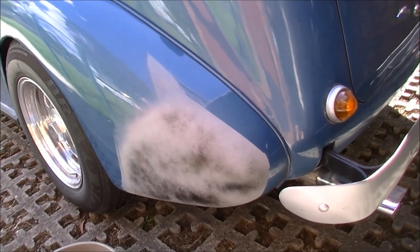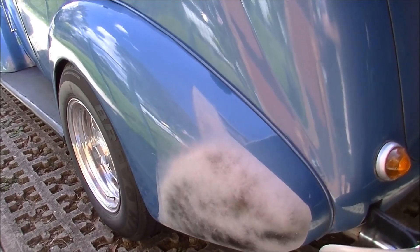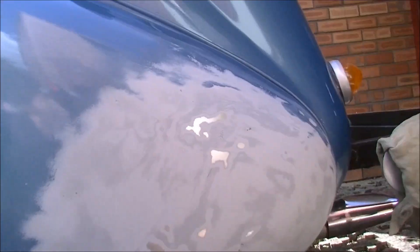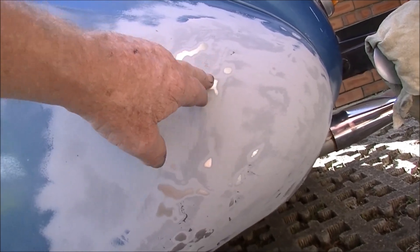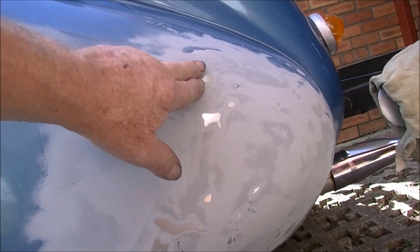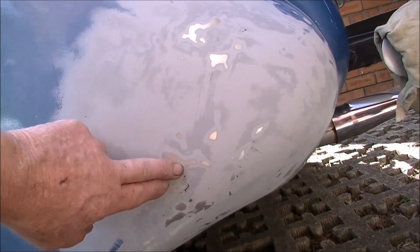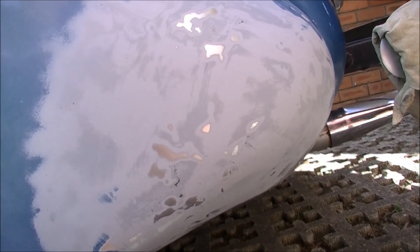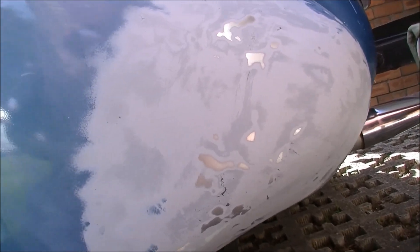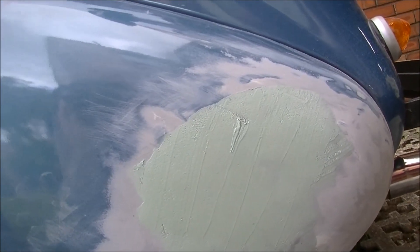But today, rub it back and see if it needs a bit more bodywork — might need a bit more filler somewhere, just see how straight I made it. Get the old metallic off it. I've got some high spots, a little low spot right there. I think if I get in behind I can get that up a little bit, just tap them in. Give it another very thin wipe with some filler again, see how we go. Just a touch more and we'll wipe most of that off again.